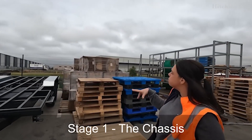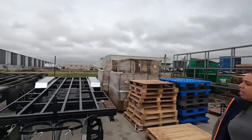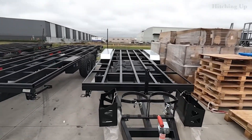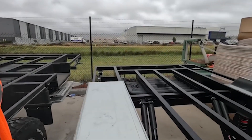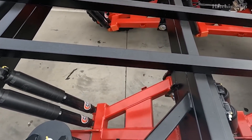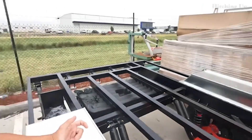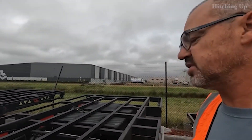The chassis factory puts on the tires, suspension, tanks, and if they have airbags, the airbags too — like that VanCraft, which is another brand. What I love about these vans is the suspension. If you have a look, it's just simple and it works. It's hard to really see here, but it's just a big A-frame, two shocks, and a big spring. Nothing can go wrong — that's why I love it. Sometimes complicated is not necessarily better.